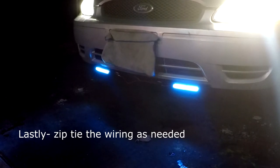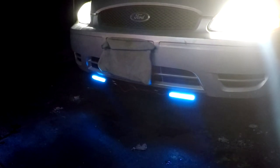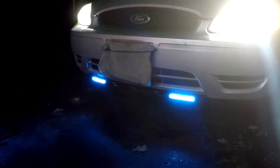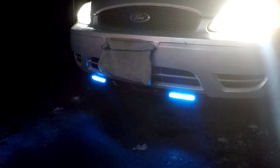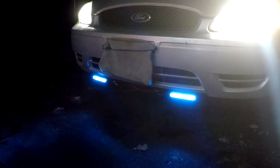Looks good, I like it a lot. Pretty much you figure out where you want to put your aftermarket driving lights, run the red wire to the positive somewhere — whether you put a switch in the dash or you put a direct link to your headlight — hook up the ground wire, and it should work just fine for you. Then of course it's a matter of adjusting the lights to shine down the road and not blind people.